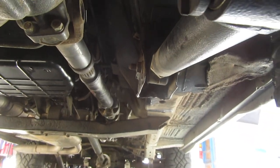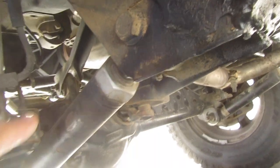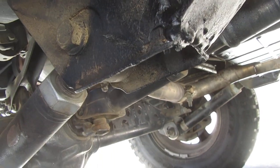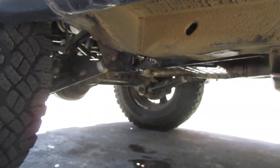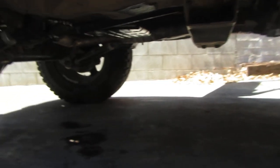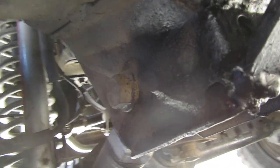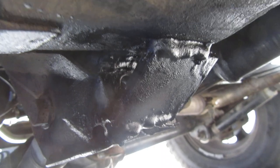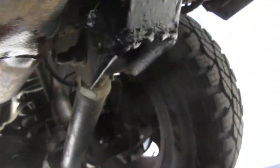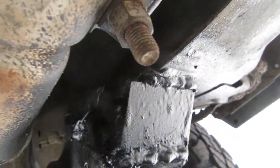I was still having issues — the left side of the vehicle bounced oddly. While inspecting the rear, with the control arm out, I found a crack — it was cracked completely off. That's not good; the whole thing could break off and the front wheel could end up underneath the vehicle. I've seen photos of that. So I took it to my muffler shop and they welded it up, and also addressed the beginning of a crack on the other side.